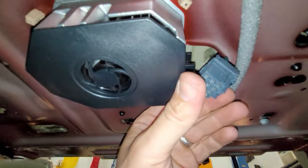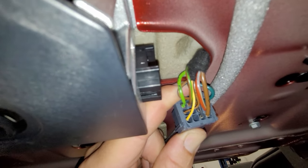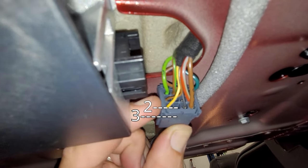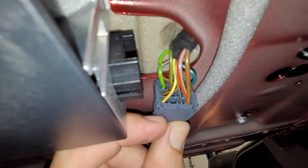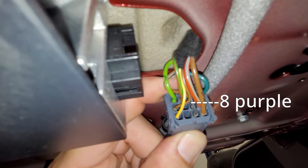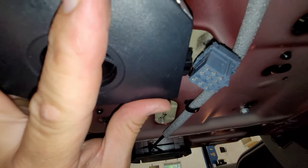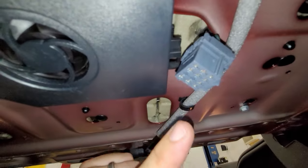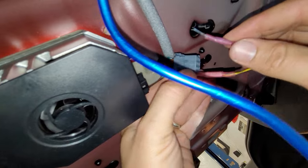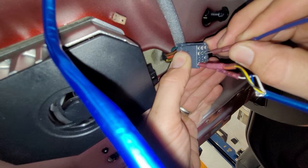Here's our subwoofer amp and here's our plug — it's unplugged. There are 12 holes. Starting at the top left, that's one; brown is two; yellow is three. We're going to plug into pins two and three — brown and yellow. Pin eight, the purple one behind the black, is our power cord — the one in the middle, not the black little one on the side. We can unplug the factory sub and plug our wire straight in: RCA positive goes in the yellow, RCA negative in the next pin, and the remote goes to pin eight.